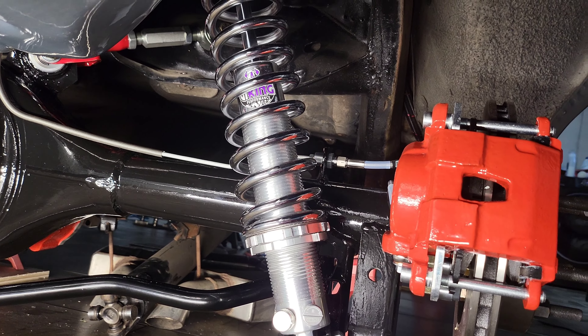If not, you could get by running solid lines to the front and an adjustable one in the rear. I was going to do an adjustable line but I can always add one later. I believe with these old-schools when you run disc-disc there's no actual bias difference in that block — it's just a straight-through block, but I could be wrong. I messed one of my lines up using an old tool, stripped one of the fittings — had to buy a new line. My mount is not a factory mount location so I had to re-bend the lines, which really sucked. Going over all the lines and tightening all the fittings. This video is mainly about making and mounting brake lines for the nine-inch housing — there's not a lot out there on that. Brakes are done, fully tightened up.